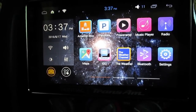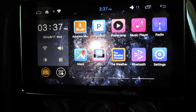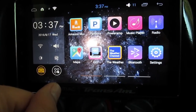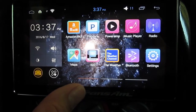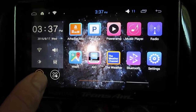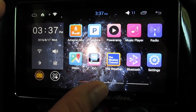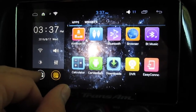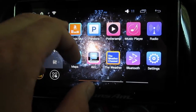Here's the stock Joying launcher — if you've had other Joying radios you can see it's a little different, with the time on the top and some icons. I installed Nova Launcher and Next Launcher, but they won't set as your default launcher. Whenever you press the home key it takes you back to the stock Joying launcher, which is fine — the keys are big, it's really responsive, and I actually kind of like it for a car radio because you want big buttons.